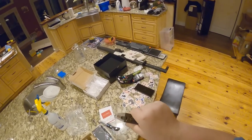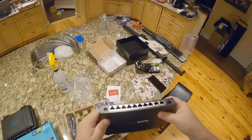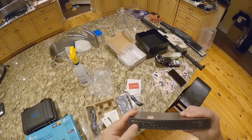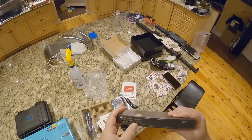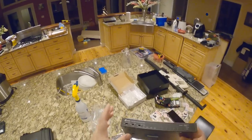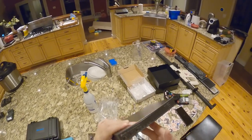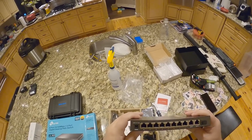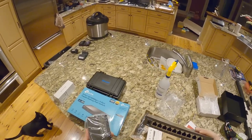There's an uplink port for fiber or a card, a Kensington lock, and two other uplinks. It doesn't have the gigabit ports labeled, but there are extend modes 1.4 or 1.8, isolation modes, and recovery modes for ports one through eight. I have no idea what the recovery setting means — it says 'caution, read instructions before activating recovery.' It's unmanaged, which is what I wanted.